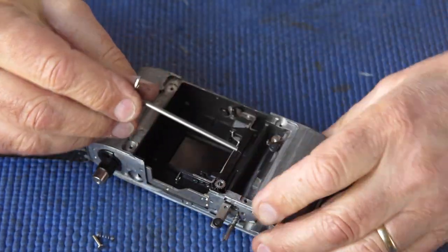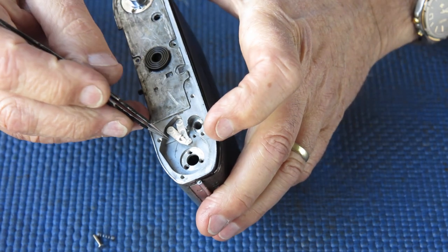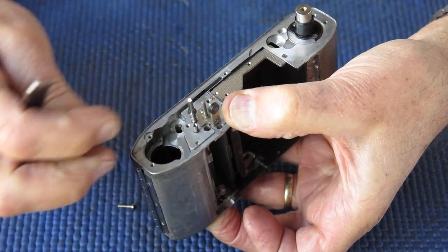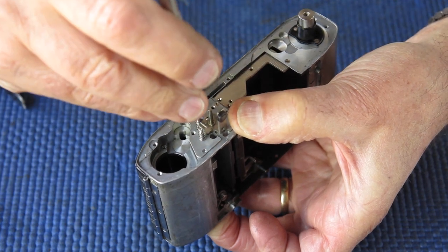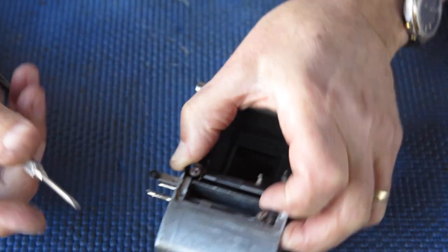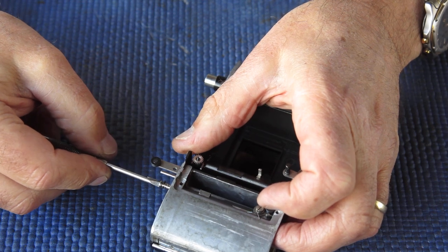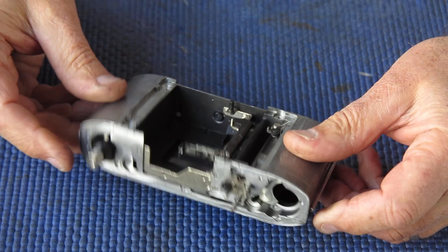The release lever next. Release lever drops down here in the corner. When you're putting it in place, be careful of this spring here. Don't catch it on the end of the body. You'll make a mess of it. You'll bend it up out of shape. And you don't want to bend it up out of shape because there's every likelihood you'll end up breaking it trying to straighten the thing up. So I'll put its return spring on the top. And this has a large headed screw on the top, which is adjustable. And you adjust that screw by winding it in or out to synchronize the release of the shutter with the release of the film advance lock. That's down far enough to keep it in place. That's probably about right. So there's our lock lever and release lever in place in the body.